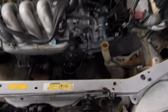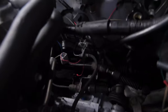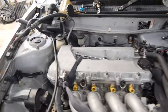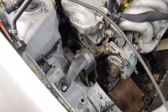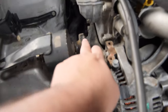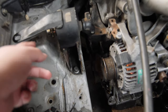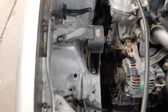The original mounts are up over here, here, and at the back of the engine. This mount here is welded — we used the original bolt that came off a 20-valve, cut that off, spaced it up a little, welded a bracket here on. This is going to be removed now, and then welded the bottom to the base plate over there.